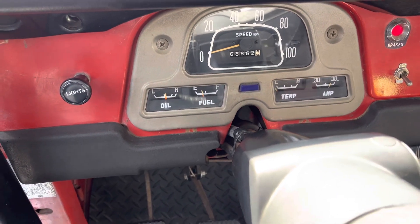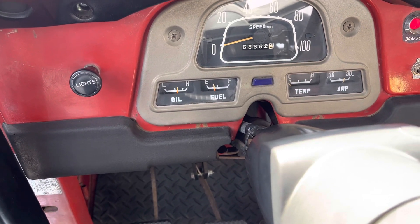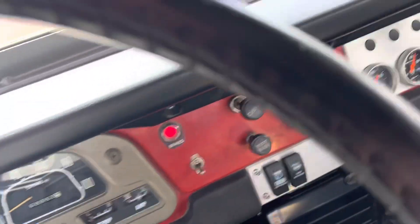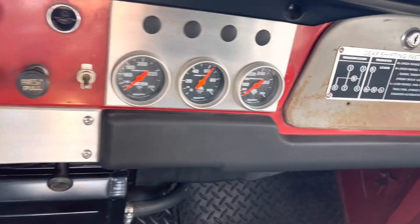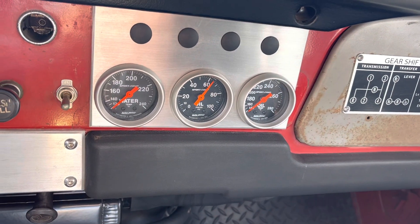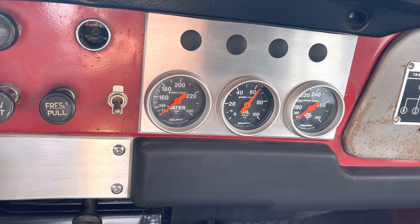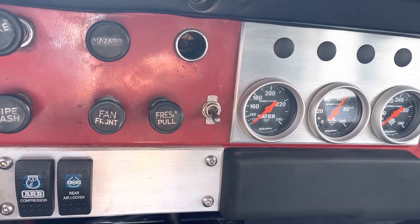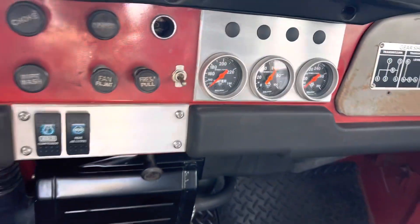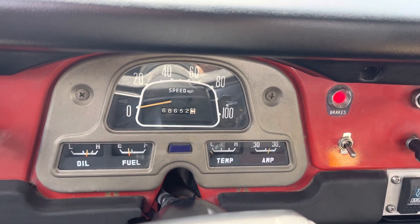It comes alive. Oil pressure gauges up to over half. These are the manual gauges that I installed. All pressures about 65 pounds — water temp is cold. You can see the alternator replenishing the battery after start.